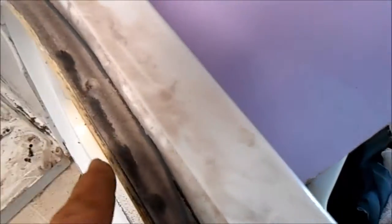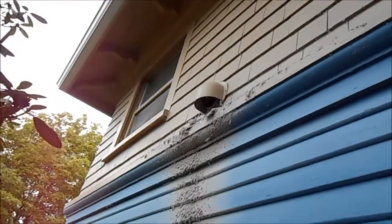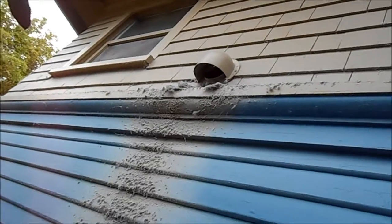What I'm going to do is cut a little piece of wire and put it right in here so that gap is closed off a little bit, and I'm going to glue it so that seal stays forward. I put a couple of drops of Teflon lube on it at the darker areas, and I'm going to use my favorite glue — E6000, one of the best glues I've found — to glue a little piece of that wire in there to keep that felt seal forward so it rides more evenly on this nylon bushing. You always want to check your airflow — this one needs to be cleaned a little bit around the edges, but it's got good flow.